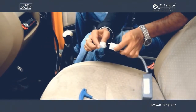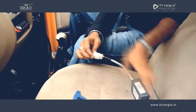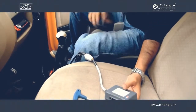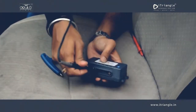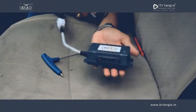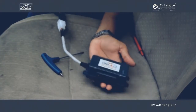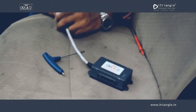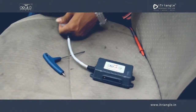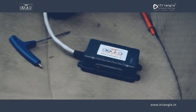After the wiring and other procedures are completed, connect the field wiring harness to the device. This will turn on the device. Finally, turn on the battery switch by sliding the battery on-off switch away from the USB. It is mandatory to turn on the battery switch to charge the secondary battery. Finally, disconnect the main power to check whether the secondary battery is enabled. After disconnecting, blinking of the device LEDs confirms proper functioning of the secondary battery.